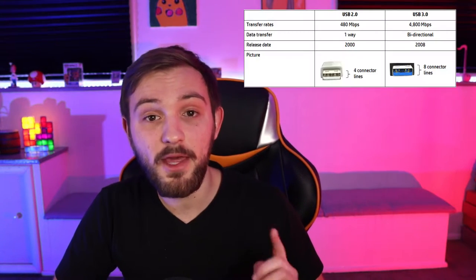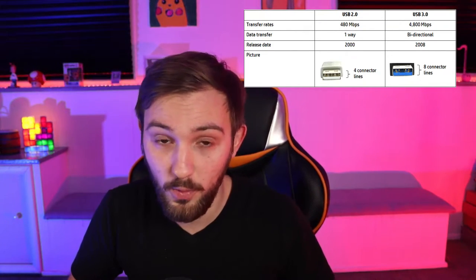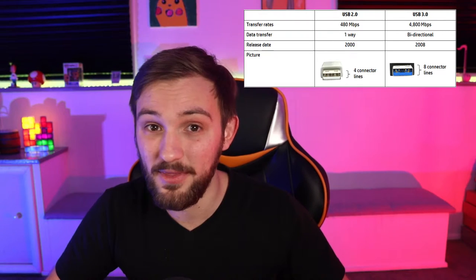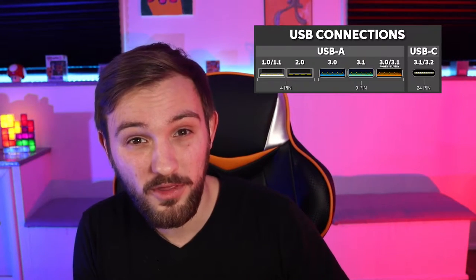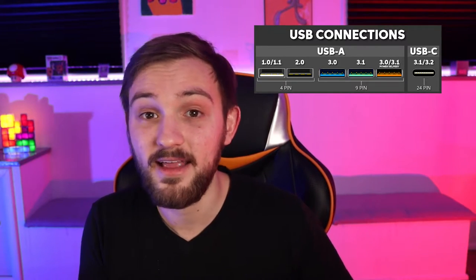First, I think this will be the most common issue, if it's not already: make sure to plug it into a USB 3.0 or better port. This doesn't work at all with USB 2.0, it just can't handle that much data being transferred. Ideally, you want to use a 3.1 port, which is the more teal compared to the more blue USB 3.0 ports. Those can accept more data.